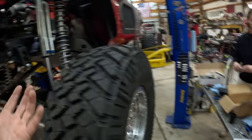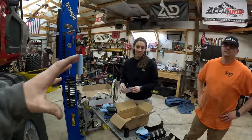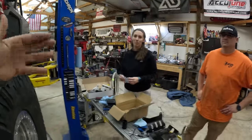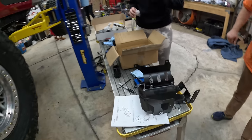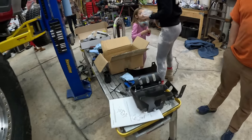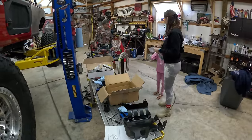With this Holley oil pan, they took it one step further — not only are they making LS swap oil pans, but they now have them as an off-road oil pan where you can incorporate a pre-built skid plate. It takes a lot of guesswork out of building your own skid plate. On a factory-engine JK there are companies that make oil pan skid plates, but once you put an LS in there none of those fit. This pan has bosses for mounting built right in. It's 3/16ths, which would probably be enough, but since this is a King of the Hammers rig we're going to bolt it up and see if we can weld more plates onto it to make it one more step bomb-proof. Today is officially the last day of 2023.